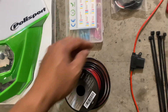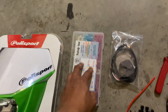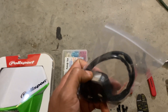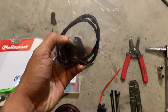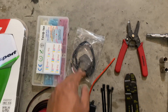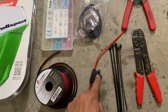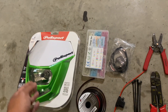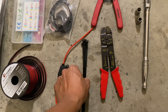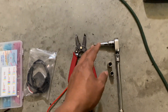Here's a spool of 14-gauge wiring. I like to use this one specifically because the positive and negative cables are stuck together so you can separate them, making the install look pretty clean. Universal wiring terminals, a generic on/off switch for the headlamp — it was like five or six bucks on Amazon and has been working really well. Inline fuse — I'm using a 10-amp fuse, which should be enough for this type of headlamp. Also wire strippers, crimpers, and zip ties to secure the wiring while routing it.